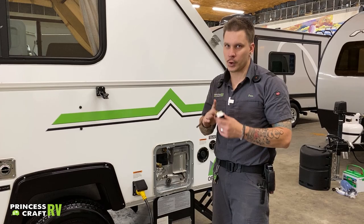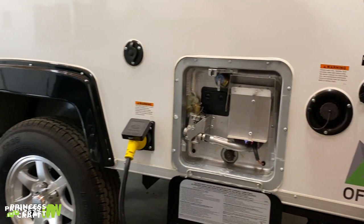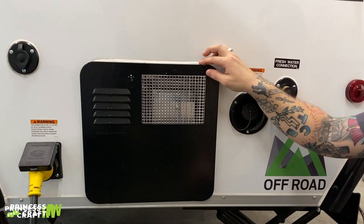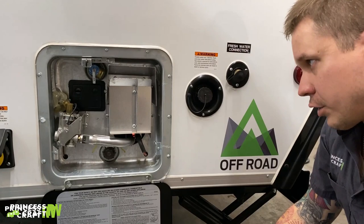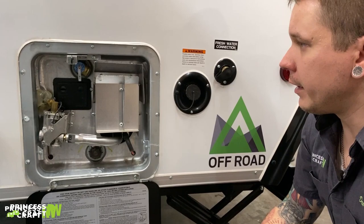6 gallon capacity water heater here. Now this is a propane water heater with 12 volt ignition. First off, from a maintenance standpoint, it is very important that we keep these screened off again from the intrusion of mud daubers and flying insects. Other than that, the manufacturer recommends that you drain it anytime it is going to be in storage for more than 7 days, and of course feed 6 gallons of water into the unit separately before using.